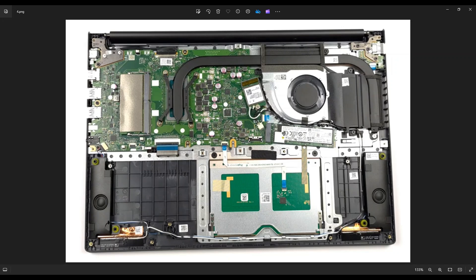The next part I'll shout out here is your RAM. You have a single RAM port for one stick of RAM that can be added. Most of you will have eight gigabytes of DDR4 memory already integrated into your motherboard. Since this computer maxes out at 24 gigabytes total, that leaves a possible 16 gigabyte max for a stick here. To operate this RAM, there are spring-loaded arms on either side. To remove it, gently pry these arms apart — the RAM stick releases and pops up a little, then you can slide it out. To reinstall, the port has a long and short side so you can only insert it the correct way. Put it in, make sure it's flush with the gold line straight, press in the middle, and the arms will latch and secure it.